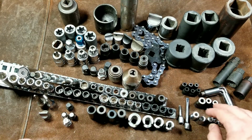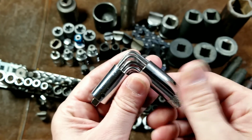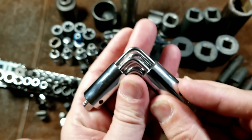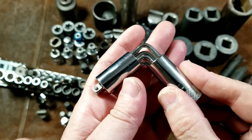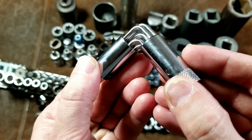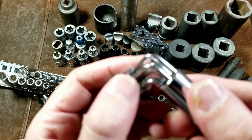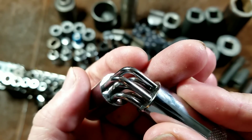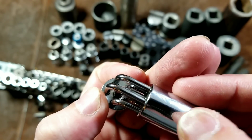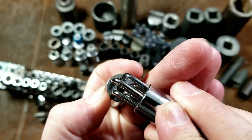Let's go ahead and start with this 1/4 inch area. We have one of these. This is a right angle, kind of a smooth action right angle driver for 1/4 inch drive. Actually, I watched a video from one of my subscribers and they had one of these, so they'll recognize it. How this works is it has a heavy center pin that's locked in via two press fit solid pins. And then these outer arms are just hardened tool steel polished, and they telescope in and out. There's 5 of them. And as you put torque on this, they want to bend over, but since they're held so deeply, they don't bend, so the force ends up trying to translate and cause it to rotate.